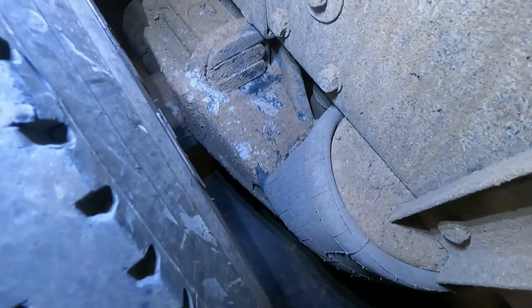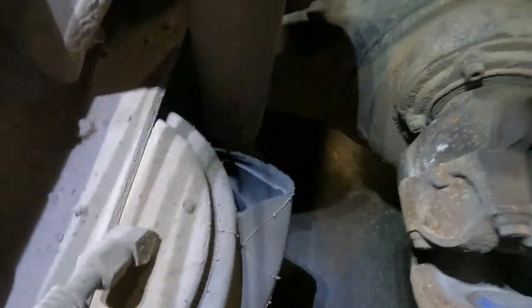So we'll be doing an emergency repair. Yeah, anyways, definitely blowed it out. So we'll get the camera set up, get it jacked up. Luckily, it's only 3 bolts and the air line. It comes right out of there, but it looks like it's sitting on a base of asphalt, which is no surprise to me. Everything on this truck's covered in it. So we'll get the jack and jack stands up and get it up off the ground, take it off.